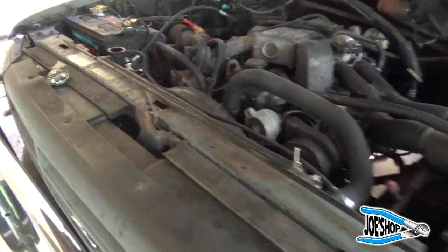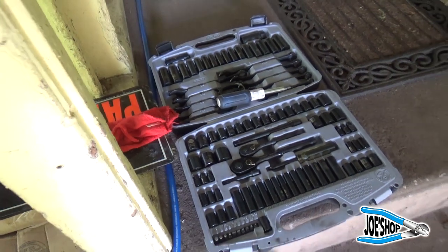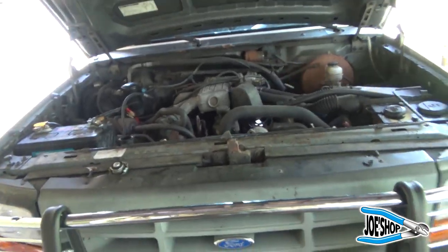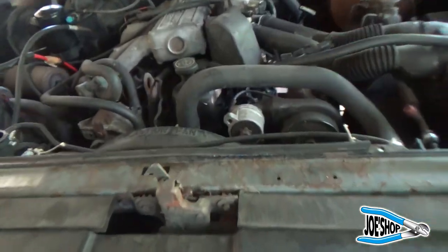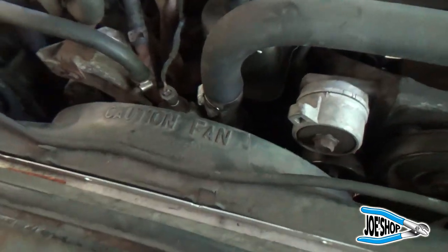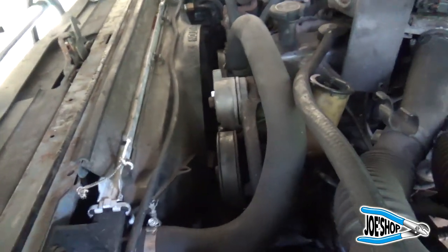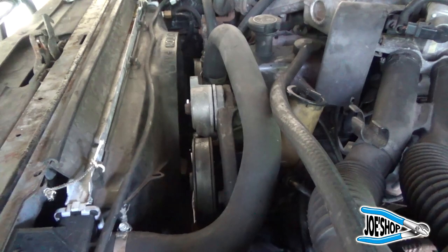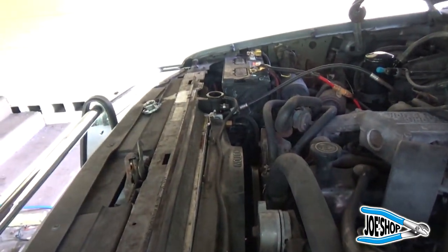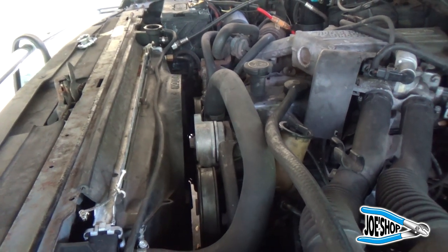I have some tools here — I carry a small set of sockets and opening wrenches with me. It's been indispensable; it's paid for itself a couple times. I keep one of those in each of my vehicles. I can possibly change the water pump here, however I don't have the air tools and stuff you really want to clean the gasket faces off well. So I'm going to try to fill this up with water, leave the cap on but loose, and limp this the 20 miles back to my father's shop so I can work on it there.